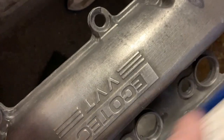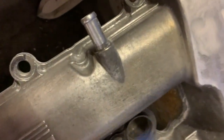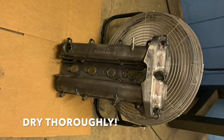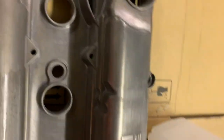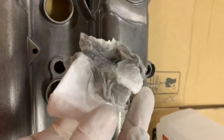It's pretty clean now, so I'm going to give it a good thorough rinse. You don't want any sanding grit or little bits of wire from steel wool getting into the engine. Once it's dry, I'm going to wipe it all down with isopropyl alcohol — you can use acetone or whatever you want — to get off any dust and oils. Look at all the stuff coming off; that's why you wipe it down.